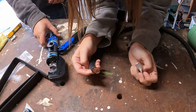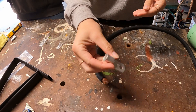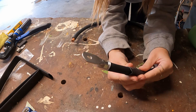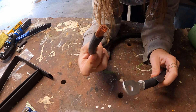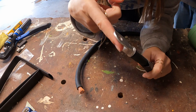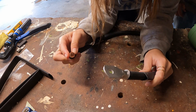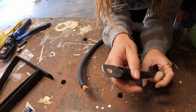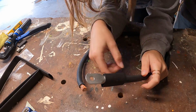This is going to be our wire for our whole system to ground it to the chassis — this is two-ought wire and I've got a two-ought wire lug. I've already crimped this lug onto one side of the wire. We're going to leave the other side open for now since the lug can't twist once crimped. Right now we're going to apply some heat shrink onto the wire lug to protect it. We don't have a heat gun, just a hair dryer, so we're going to try that out.